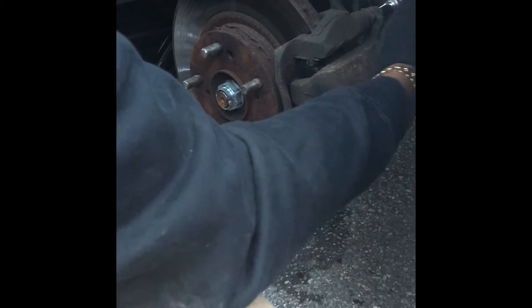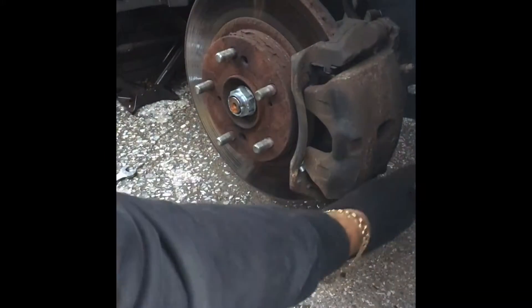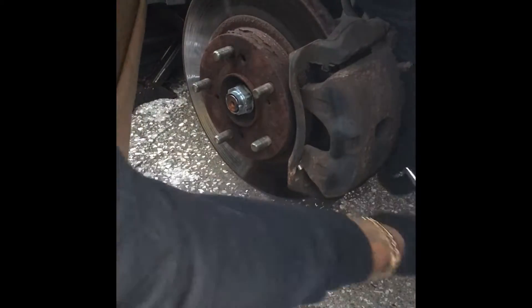Now that I've got these back on, I'm going to grab my ratchet to make my job a lot easier and go ahead and tighten the screws back up to the proper torque. When you torque your brakes, you don't have to really tighten them a lot, because the heat will expand them, making them very hard to get off the next time they are changed. A nice, good snug will do — nothing really hard.